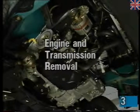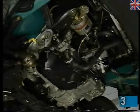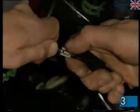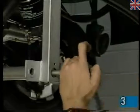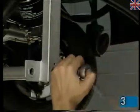Removal of the engine and transmission assembly of all models is carried out by lowering the units down from underneath. To ease removal and replacement, some of the control cables are in two sections, allowing them to be quickly disconnected without disturbing their settings. To remove only the gearbox assembly, the engine must first be swiveled forward. A special tool required to support the engine is fastened to the subframe and engine block. After slackening and removing the necessary components, including the left-hand drive shaft, the engine can be pulled forward using the screw thread. Further information can be found in the repair literature.